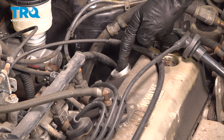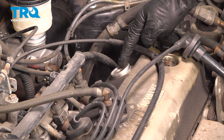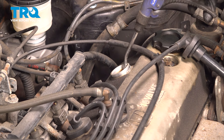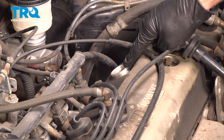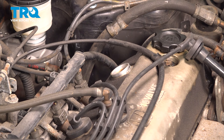The spark plug will be located inside of this port. Before you start removing the spark plug, you want to ensure that there's no miscellaneous debris in there. We'll use some compressed air. If you did see any oil come up and out of this area, that means you have to replace your valve cover gasket. This one looks fine.